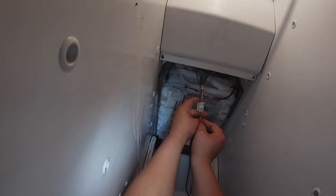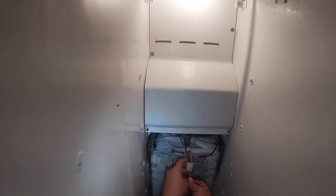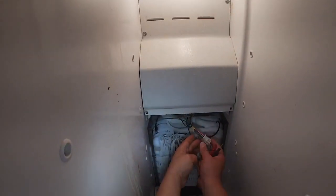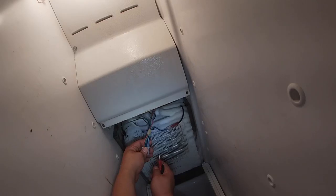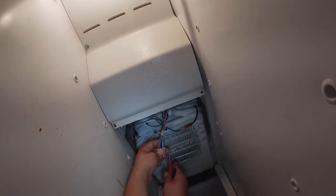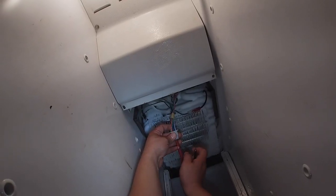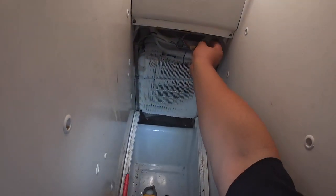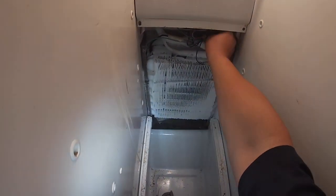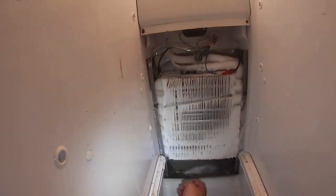also the defrost heater. Now normally when you see coils like this, the most common issue will be the defrost thermostat or the defrost heater, but not all the time, and this is the reason why I did this video. The other thing that it could be is the main control board, but not so fast. Sometimes it could be the damper.